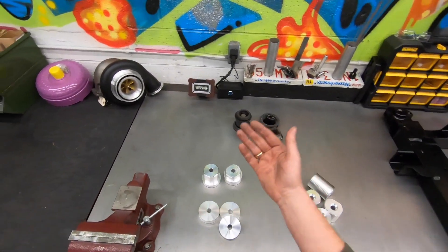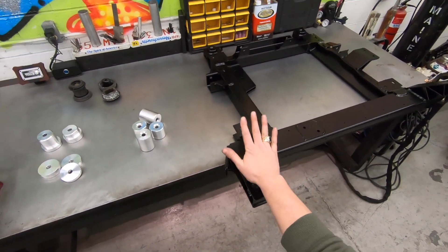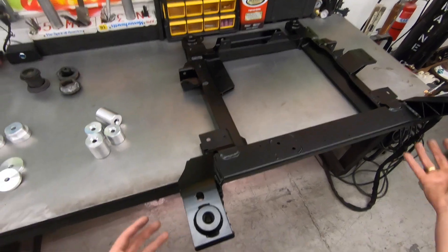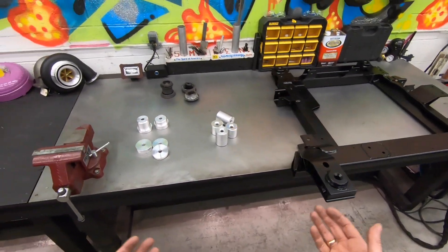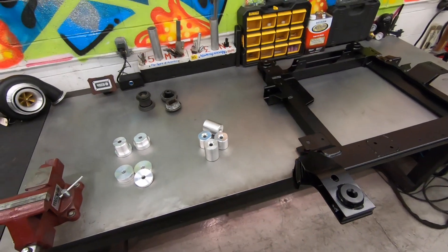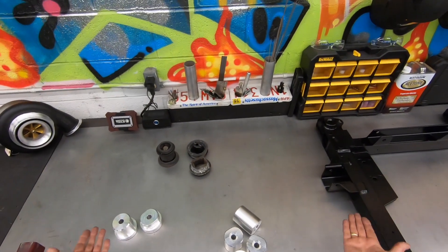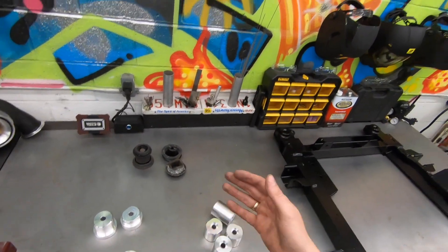The big question is: what do you gain by going from rubber to solid? Naturally, you're reducing any movement between the subframe and the frame rails. As a bonus, you've got two frame rails 40 inches apart — you tie them together with this subframe, now utilizing it as a structural component solid-mounted to the body, stiffening up the whole front of that chassis. A common concern is whether solid subframe mounts will rattle your teeth out on the street. Honestly, no. Think of an F-body — whether it's a 98-02 or fifth-gen Camaro — you have a K-frame attached to the body that's solid-mounted with no rubber isolation between the engine, transmission, and body.